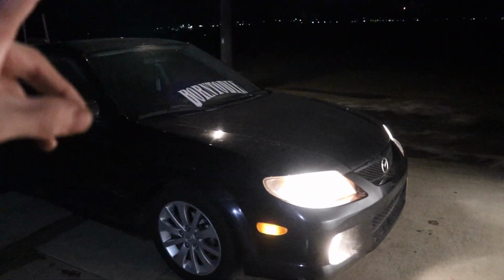All right, we just took this thing for another rep since we just did a makeshift wheel alignment on it. I had Colton sit in the car, hold the steering wheel straight while I adjusted the toe. Just held the tape measure against the fenders to keep it straight. Got the toe as close as possible on a hoist without an alignment rack. And then in the rear, we just eyeballed the camber, tightened the strut bolts up, and she's good.